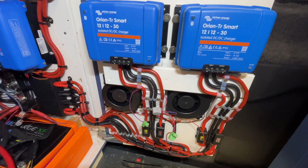With my engine started, we should see the units booting up and we'll be able to see how many amps are drawn. There we go, currently drawing 70 amps. This will go up to about 79 amps. There we go, that's both units running at max in bulk mode and drawing 79 amps, including 2 amps for the fans I use for cooling them.